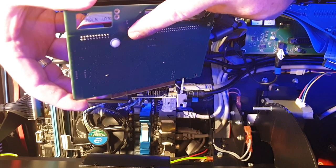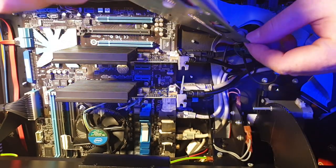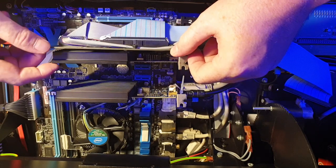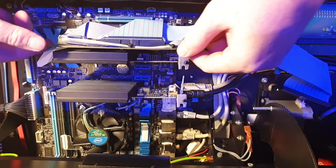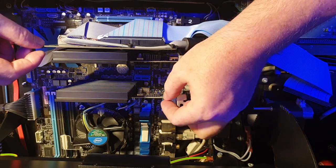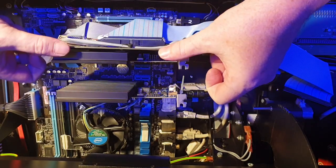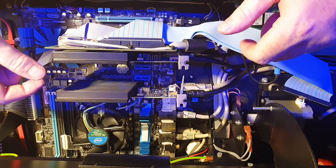Note: this foot here — a nylon plug — inserts into the board just to stop the card smashing into the graphics card's heatsink. The card is sandwiched between two graphics cards — a tight fit. The rest of the cabling insulates this board from the next graphics card. I removed the VGA connectors to improve airflow through this unit. There's also an additional slot you could put something into — a PCIe one-lane thing — maybe a sound card.